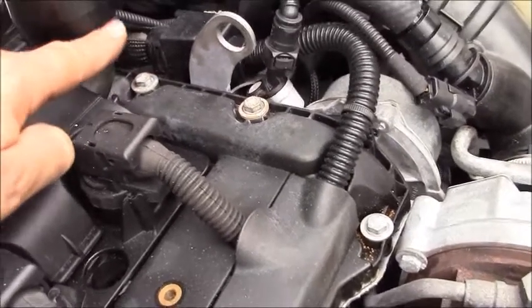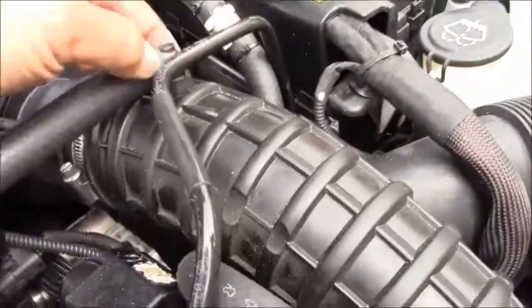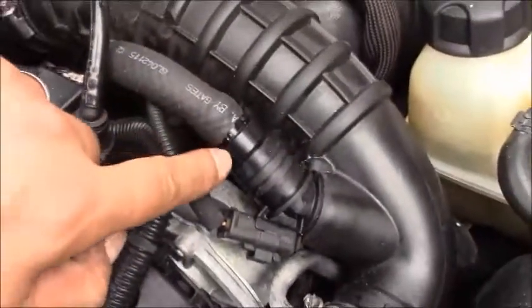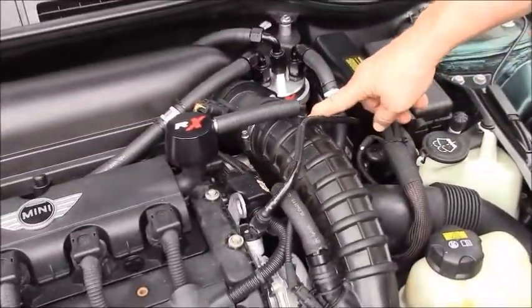When you get your kit, you just have to snip it so you get the 90. That'll fit on there. Clean side separator goes right into it. You insert a barb here by drilling a little hole, and then this piece of tube will connect it, and the clean side separator fits perfectly. Then there's an adapter here that goes into this tube with the rubber hose that runs to that secondary vacuum connection there. A 1/2-inch drill bit is the size you'll drill.